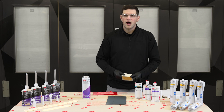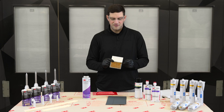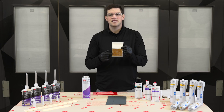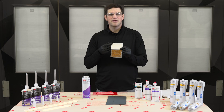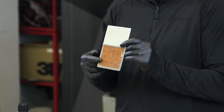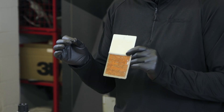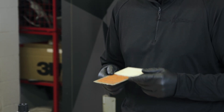When we look at why, from a repair longevity perspective, on this panel here you can see the bottom portion was coated with a 1K primer and the top coated with a 2K primer. You can see the difference — corrosion and rusting on the 1K portion, very nice and clean on the top. We're getting quality corrosion protection out of that repair.